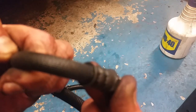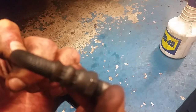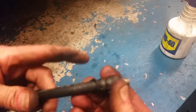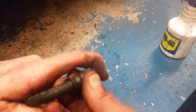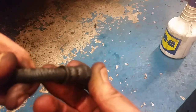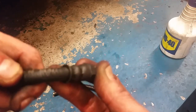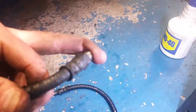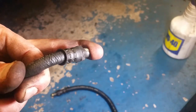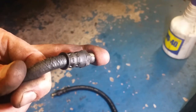Are you gonna focus? Come on, come on, baby. Focus for me. I think you got it there a wee bit. Look at that side there. That is really bad. Now, this car has failed MOT on the steel brake pipes being rusty or so bad that you can't inspect them, was the wording that was used. So that's a Northern Ireland MOT, which is an independent government agency that does the MOT in this part of the United Kingdom.